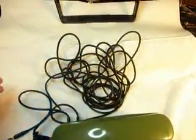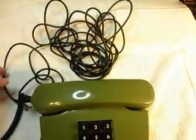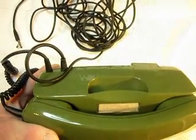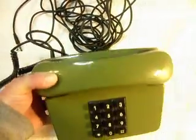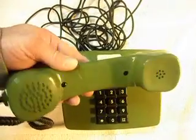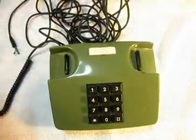That's just wild. What we're going to do is put a newer style line cord on it for him. And like on the last one, we'll put that in the back of the telephone. We will notch out a rectangle so that we can install a newer style modular port in this telephone. It's a German post office phone — I'll show you the bottom of it pretty soon.